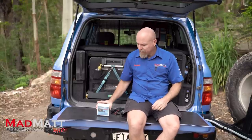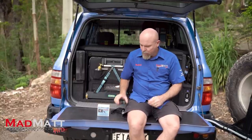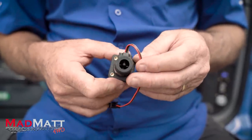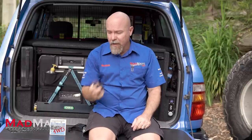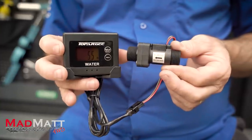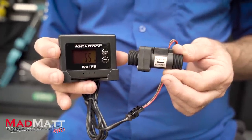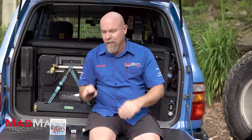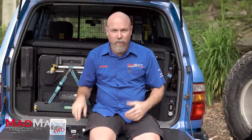What I've come up with is this: a digital flow meter. It cost me about a hundred and something dollars on eBay. I'm going to mount this little sensor — basically a little propeller and pulse generator — down in the water line coming from the water pump, and then mount this little gauge up on the cargo barrier so I can see how much water we've used.